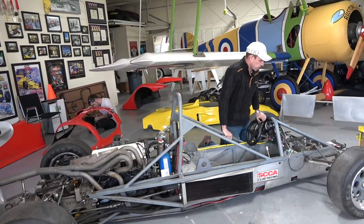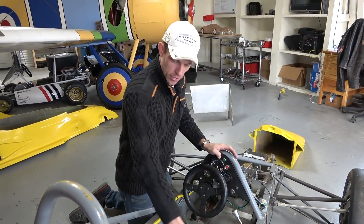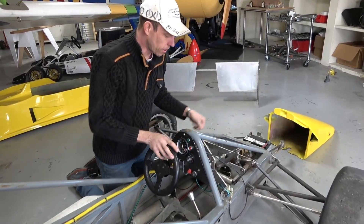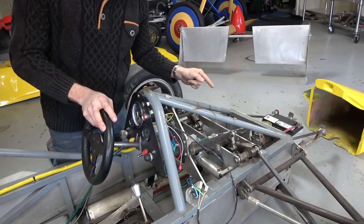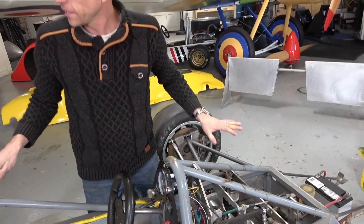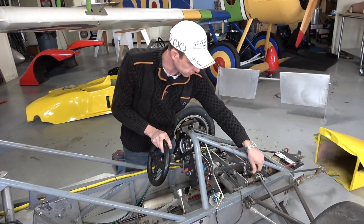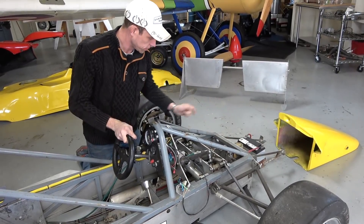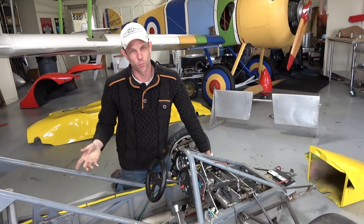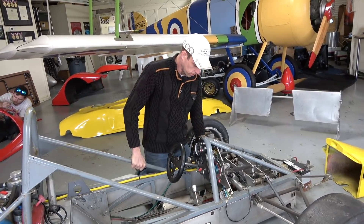The Continental really needs to be freshened up more. It's got a fresh fuel cell and I made sure the shifter isn't rubbing on it, but the frame needs lots of things painted and refreshed. The adjustable sway bar fins aren't even connected to the suspension yet because they're going to do corner weighting, and lots of nuts and bolts aren't tightened. The whole thing needs to go on scales with every nut and bolt checked, but first I want to refresh, clean, paint, and protect things from corrosion.